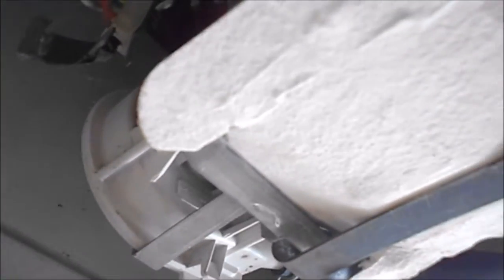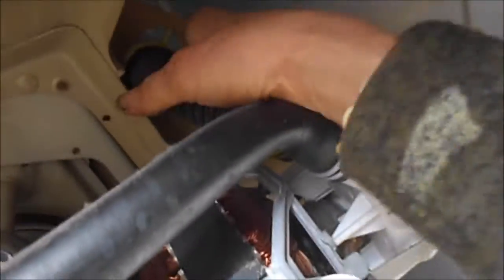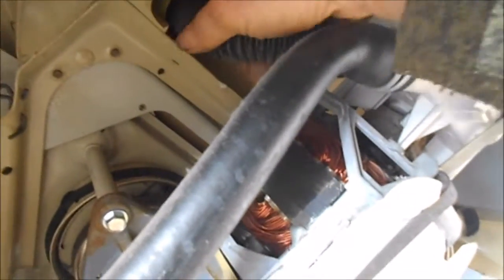Normally if your water pump is leaking, you'll see a mineral trail here, but I don't see a mineral trail or any mineral trails anywhere else to give us any signs. The hoses look good — this hose will typically crack if you put new drive couplers on too much, but this hose is good.